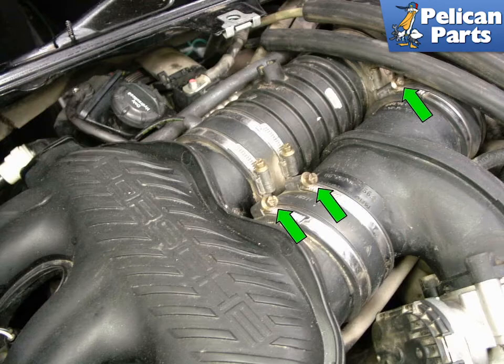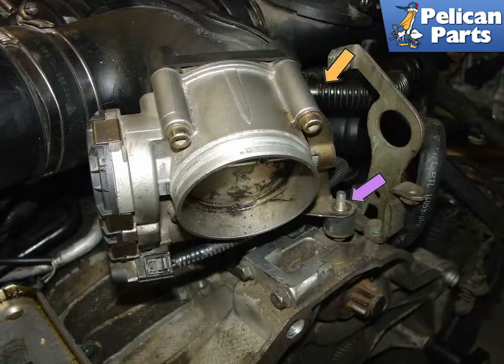On the top of the engine, loosen up the clamps that hold the intake tube that is connected to the throttle body. You will need to loosen them up enough so that you can rotate the throttle body up and out of the way. With the intake air snorkel disconnected and out of the way, loosen up the bolts that hold the throttle body to the engine. The design of this mount varied slightly over the years, so you may have to improvise a bit.